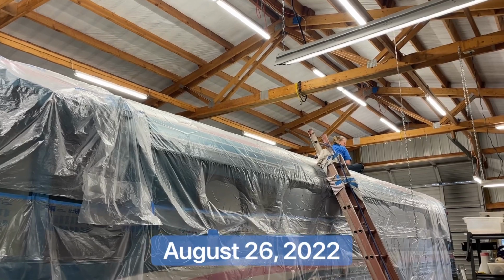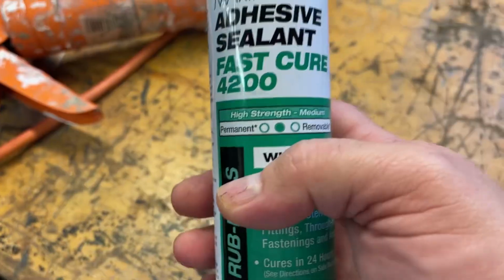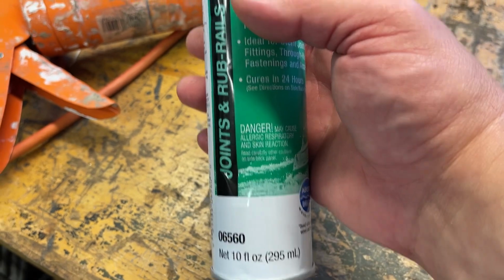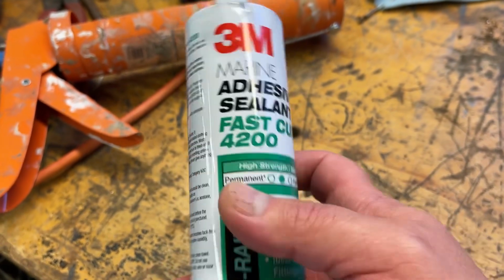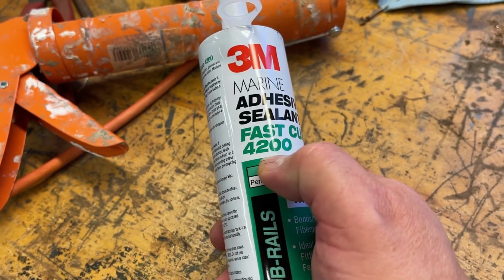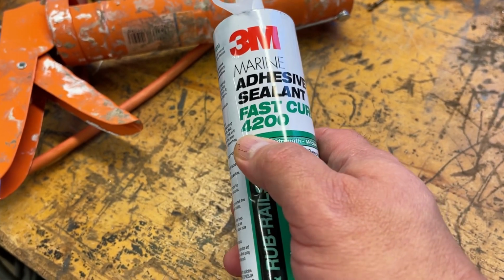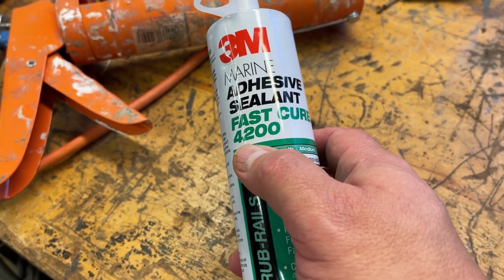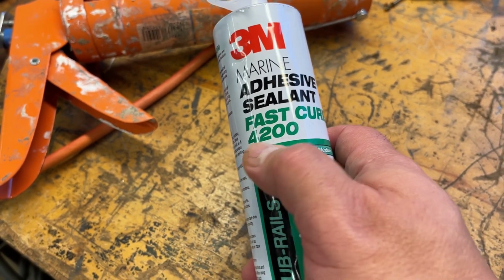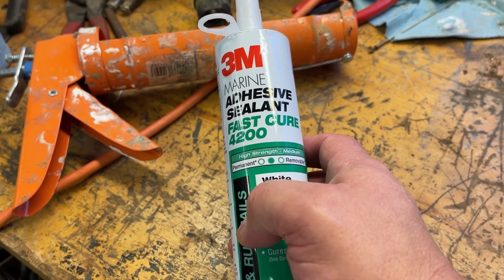All right, several days later, and we're getting ready to bond these panels onto the roof of the bus along with rivets. We're using 3M 4200. I'll try and remember to put a link in the description down below for this. They have a 5200 product. It is much more permanent. You'll have to destroy things to get it apart, like a weld. But this is supposed to be semi-permanent, so I'm going to give this stuff a shot.